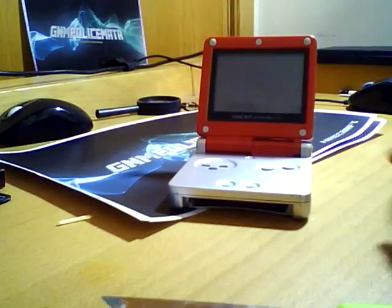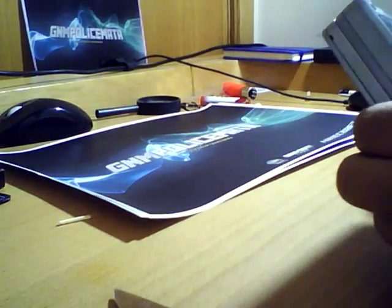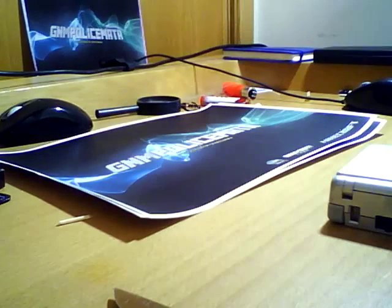As you see, the other one has a broken screen. So I'm going to tell you how exactly to disassemble this. First of all, don't ever use the wrong tools. This may seem pretty obvious, but many people try to disassemble this using makeshift stuff and they end up screwing their Gameboys up. Second, get a box or something to store the parts and several small boxes for storing the screws. Also, if you can, grab an anti-static bag to prevent any static electricity damage to the motherboard.